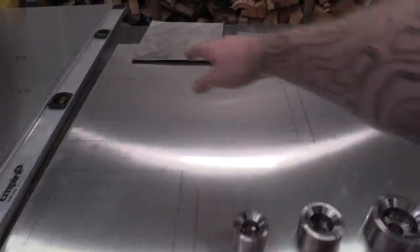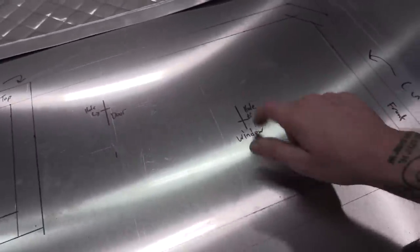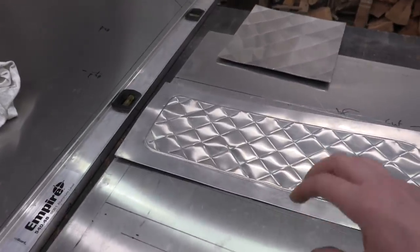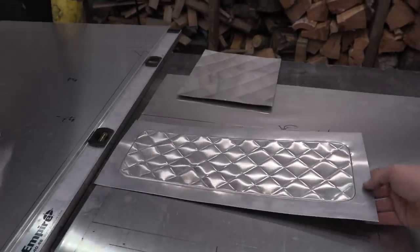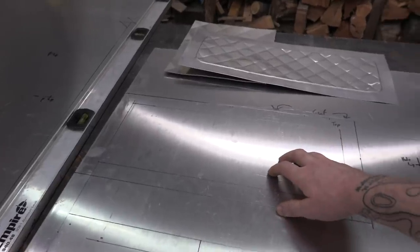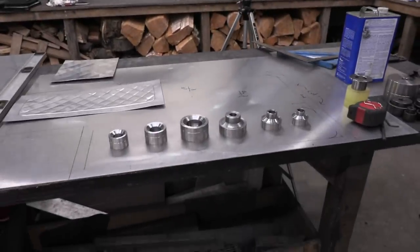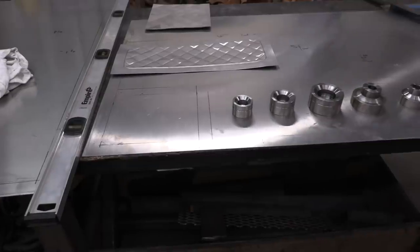I'm going to trim out the panel for the door, drill a hole for the door latch, drill a hole for the window roller upper, and then bolt that onto the Jeep. Then I'm going to put these little beauty panels on top of that. A lot of times people incorporate designs directly onto the door panel, but this lower one is going to need inverted dimple dies — I don't have the tooling to make shapes like that, have it distort, and straighten it out in a way I'll be proud of. So I'm going to bolt the base panel onto the door, make smaller panels I can straighten off-car, and bolt those down over it. That's the best compromise to get a decent look without pushing my beginner skill set to where I keep destroying large pieces of material.